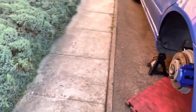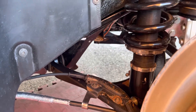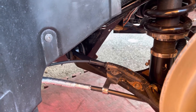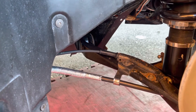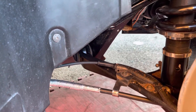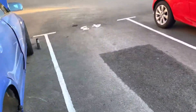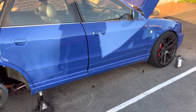I've also adjusted the suspension on the BC coilovers so I've got it sitting a little bit higher, because I don't like how the previous owner had it — he had it very low. Every bump you have to go extremely slowly, and when you're driving a bit fast and the road's bumpy, as soon as it bounces you can hear the tires rubbing up against the arches. The front driver's side arch is completely demolished on the inside from the tire rubbing against it, so I will make adjustments to the front at a later date.